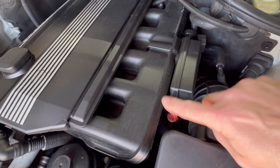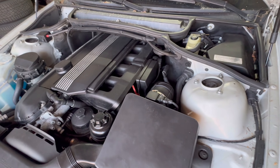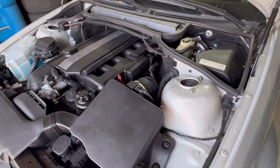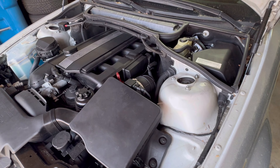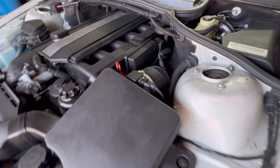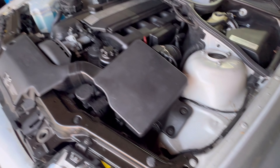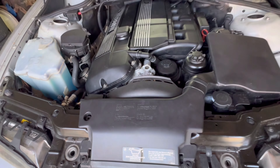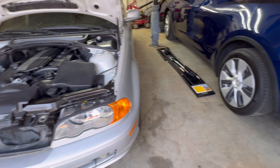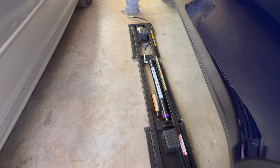We need to free up this oil dipstick tube because that goes right into the pan. We don't want to be messing about with that as we're trying to fit the oil pan back. We need to get to the bolt that holds that in place. It's usually easy once you get this intake tube out. So we'll get the air box out - just a couple of tens. Already got the rivets out for that. Then we can get her up in the air using the quick jacks.